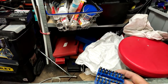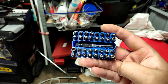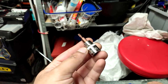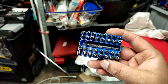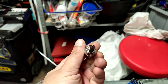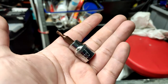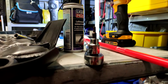Just a quick note for the MAF bolts: if you use something normally like this — your security torx, they have a hole in the middle and they're six-sided — but the one that the Honda MAF bolt uses, for some reason, is a five-sided security torx. These are TS bolts; it's either TS-25 or TS-30, but these six-sided security torx bolts won't work. I had to order some others, and they didn't work, and so on and so forth. I got these off eBay and they work absolutely perfectly, so you will need these. To confirm: the MAF does have TS-25 torx bolts, so you'll need a TS-25 bit.